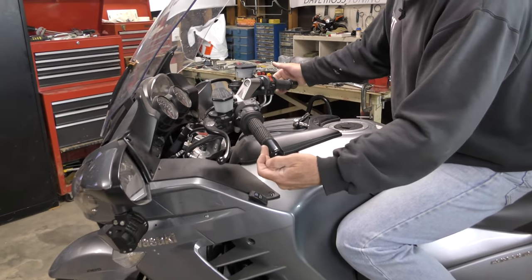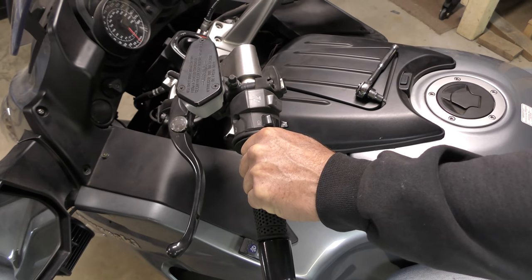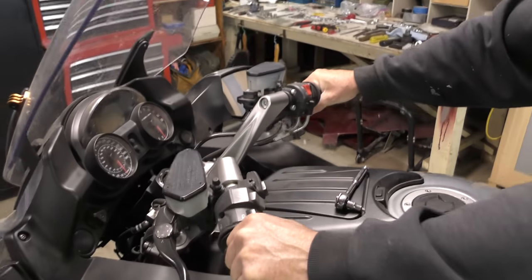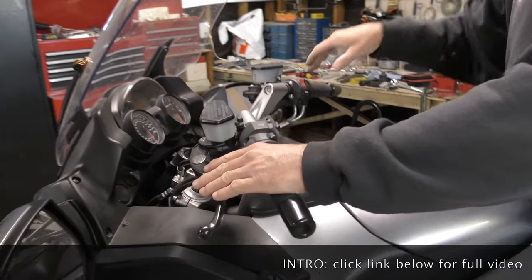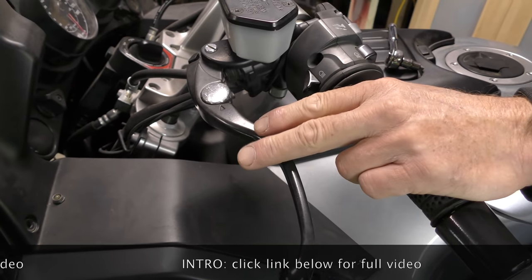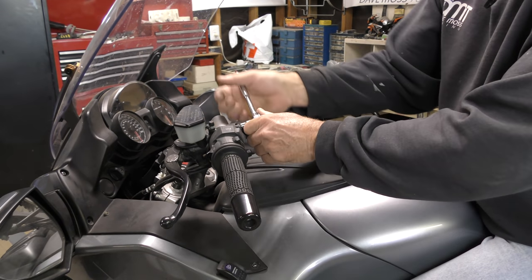Massive difference here to there — so adjustable versus adjustable. If I want my hands square, look at the line of my fist compared to the handlebar itself — I'd need the bar to come back and go straight across. I may have to find a machinist and fabricator and buy some billet, which will be expensive, but we'll see. We anchor with our thumb and put our hand on top to get everything straight. My hand is high — the reach is perfect — but this is too high because I have to go back to go forward. Let's see if it's adjustable or pinned.